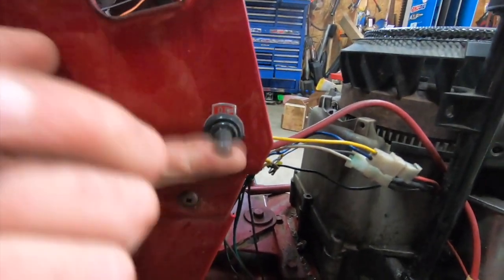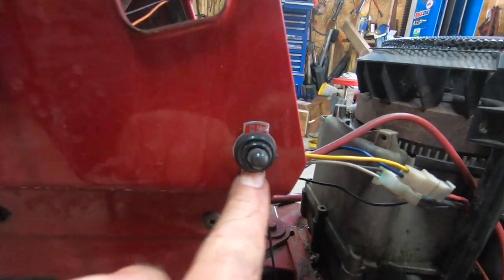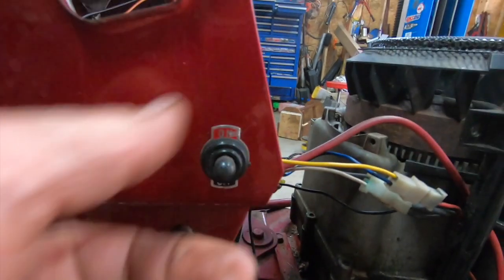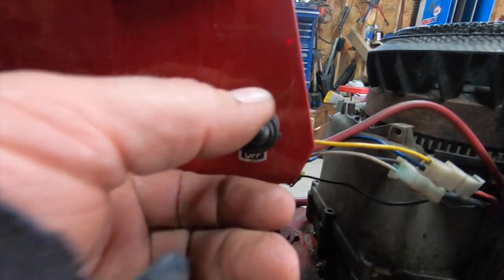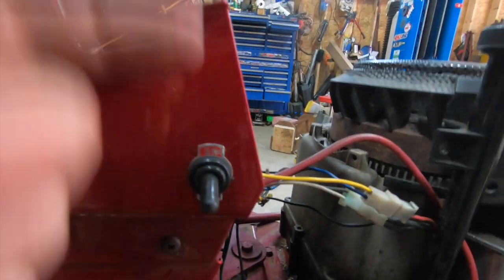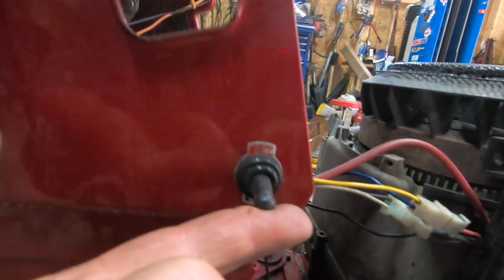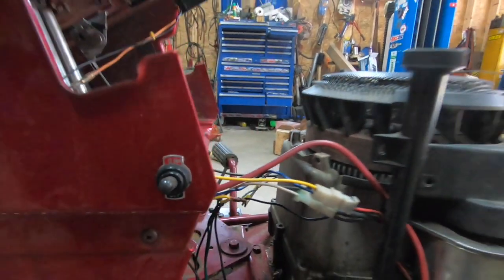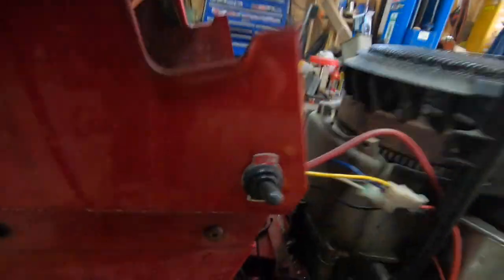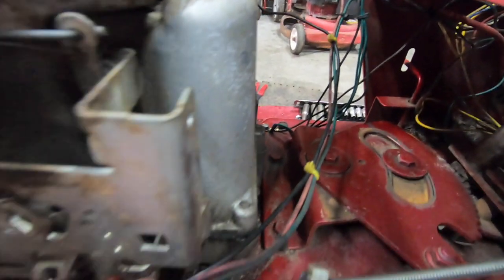And so this is, I had to take the little pin out of the on-off thing here to flip it around, because on is off and off is on, because on means you got continuity. We got continuity to ground. That means we got no spark. So I had to wire it backwards. So that means we'll have spark because it's off. But it's really on in our case. If you're not confused enough by that, we just ran the wires down here.